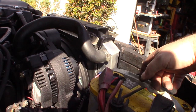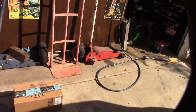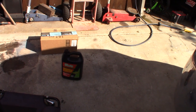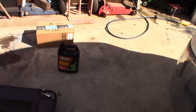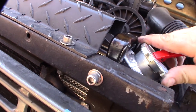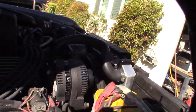All right, getting the thing filled up. I'm going to use the cheap coolant now because I change it so often — I'm always draining it — so I don't get the expensive stuff anymore. I have a gallon of distilled water and a gallon of that. I got a new 16 PSI cap. I love these twist-off ones where you can actually let the air out first.